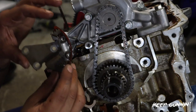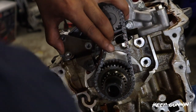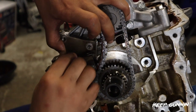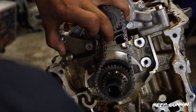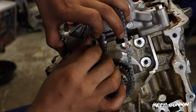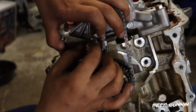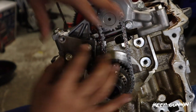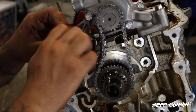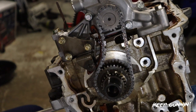Remember how I told you this is spring-loaded. So we get one 10mm in, let's try to get this one in first. There it is. Grab our second one, get that guy in there on the oil pump. Just got to give it a little tension - you just push it forward, and that would be the last one. Tighten these three 10s up.